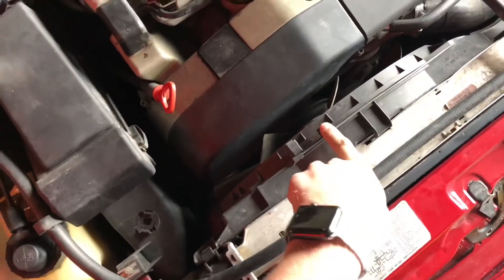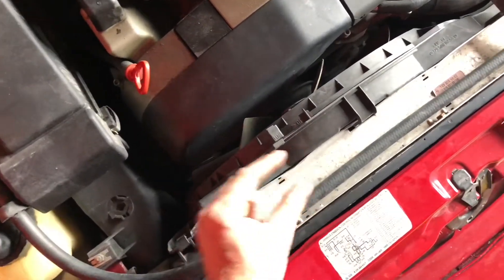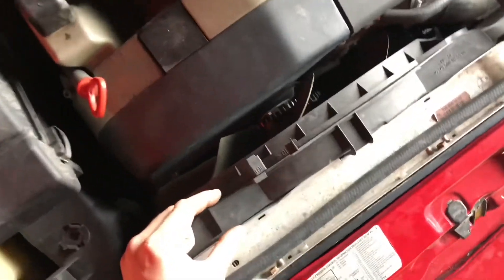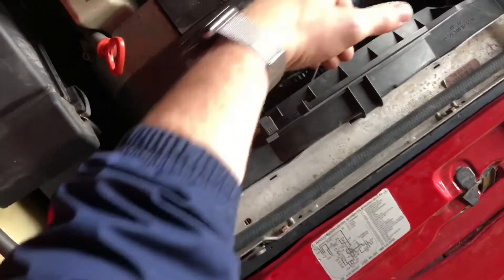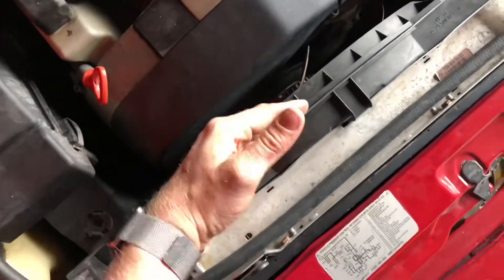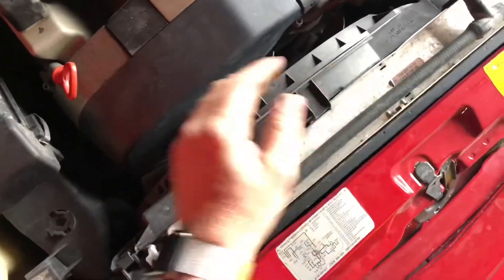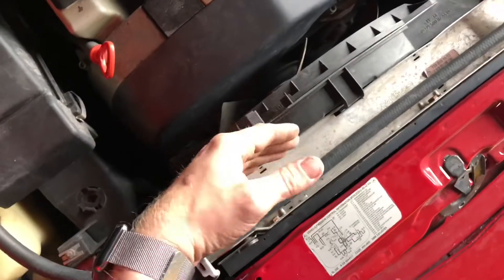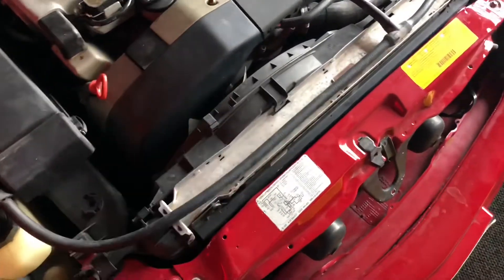I think this is even the same way on the 2.6 190s. It's a two-piece shroud — you don't have to pull the fan to take the shroud off. The main shroud is actually thin enough to get between the fan and the radiator, and then this does a slotted rotate and slips over the fan. You can slip that down first, leave it there, put the shroud in, and when the shroud is fastened, you can just pull this up against the main one-piece shroud and clip it on. It still directs the air just as well. I'm sure it's a cost thing, which is why you don't see that often on other vehicles.